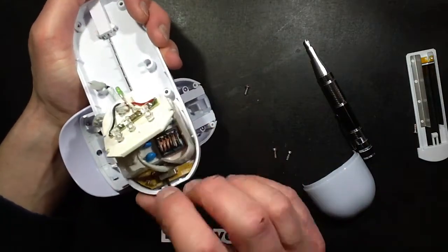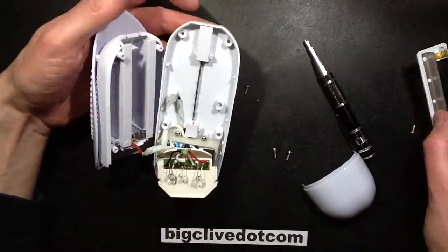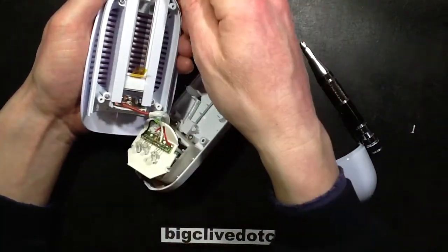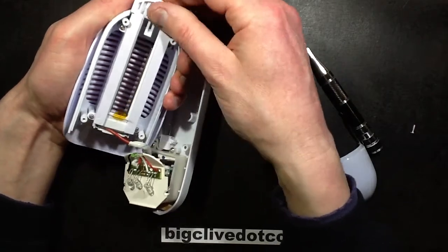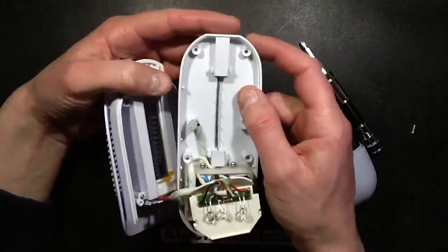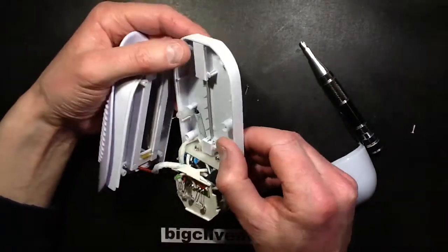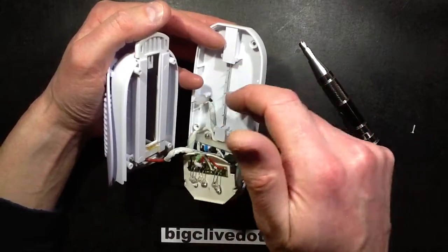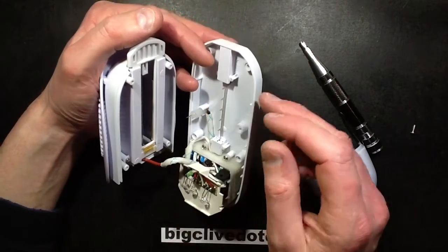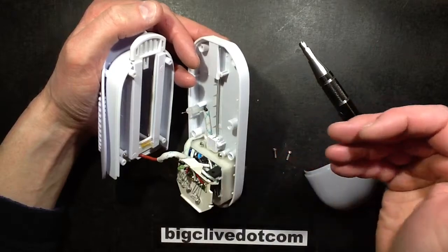I wonder what that does — maybe it just puts another resistor in line with part of the control circuitry. So, how it generates the airflow: when you slide these plates in, it makes electrical connection with one side of the high-voltage supply. The other side of the high-voltage supply, positioned just behind it, has a series of sharp points — just a metal strip that's been punched out with a rib for strength. When you put a high voltage between the points and the grounded plate, you get a corona discharge at the tips of the points, which creates the ozone. And because the flow of charged air goes towards those plates, it creates quite a strong airflow.